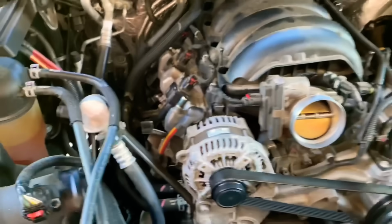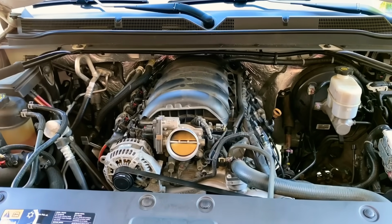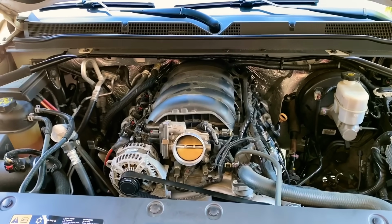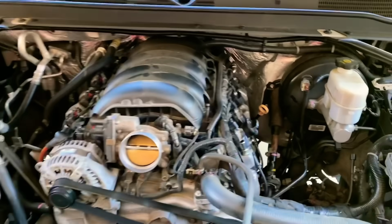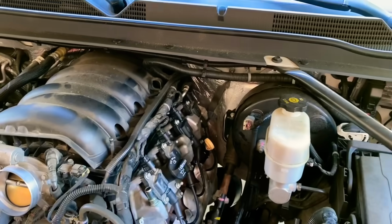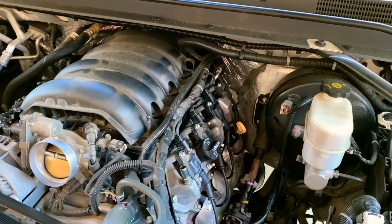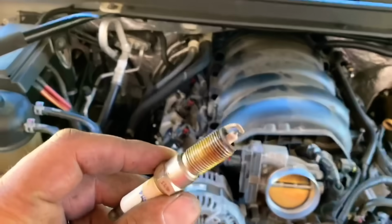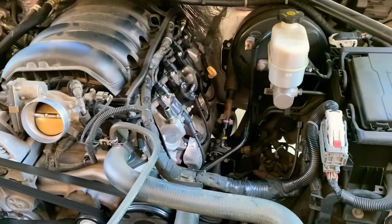So that's telling me maybe that coil's gone too, but it's only giving me a code P0307. If you ever get a P0303, P0302, that's a misfire in that cylinder. So right now, maybe only 7 is giving enough of a headache to make the computer see that it's a misfire. But definitely my plug over here is wet on number 6. So I'm gonna have to order all new coils, but they only had one in stock.